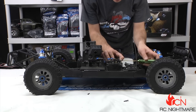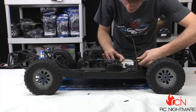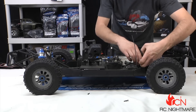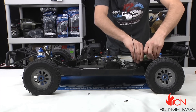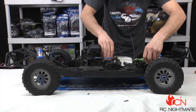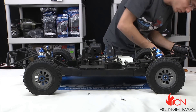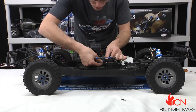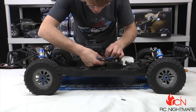Torque this down. I went as long as I could on these screws going into the bracket because there's not a whole lot of meat there, so I measured it ahead of time — again I think maybe 23 millimeters, but you'll have to measure it for yourself to be exact; just bring the bracket with you to the store. There's really very little work involved: you're drilling two tiny holes in the plastic bracket, all you need is a hand drill, then sticking on the two screws. It clears all the stock linkages with no adjustments to be made.